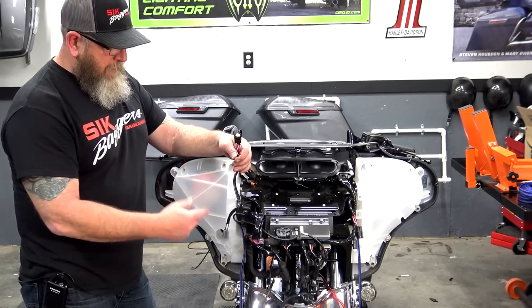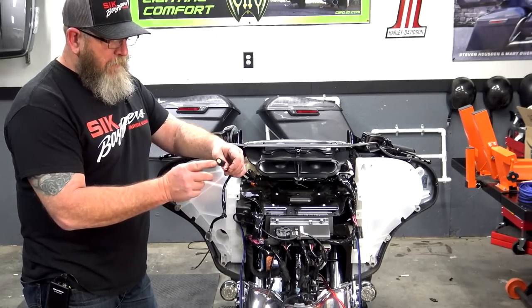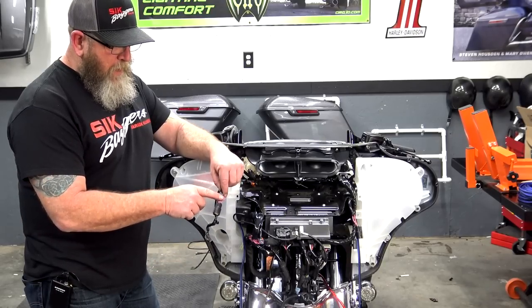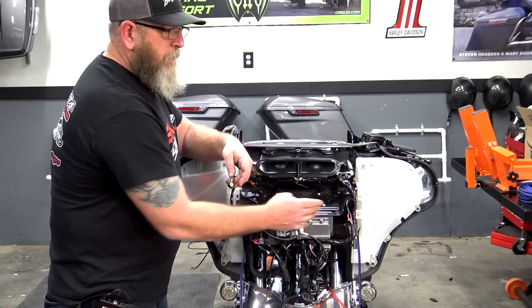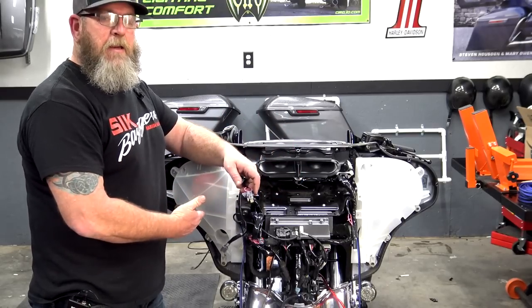This is the one that we disconnected, and over there on the table we took that wire out and threw it off to the side. That's where that connected. Now you've got two choices here, guys. You can jump right off these wires right here, or you can go ahead and cut this off. Either way, these two wires are going to go into the line out converter, out of the line out converter, into the amp, out of the amp, back into your speakers.